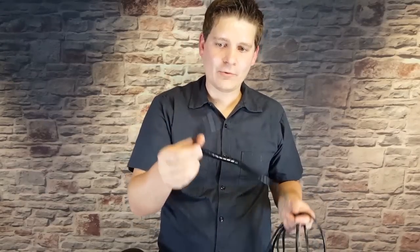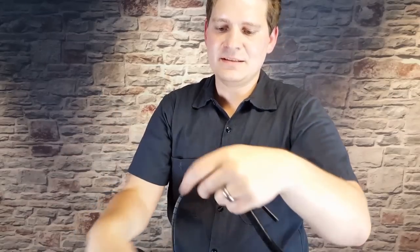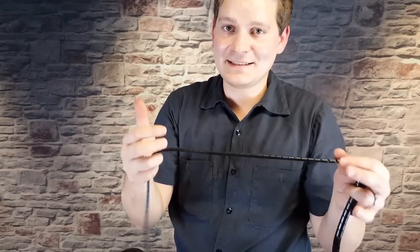There are a few different things you can get - some different wire wraps. This one splits in half so you don't have to twist it around, which makes it really easy to put on. This is a smaller one and it comes in different sizes, so be aware of that if you're looking at a picture online. I used to use these a lot because it looks nice and clean and keeps everything tight. The downside is if you ever want to change anything or access your wires, it takes more time to unwrap things. So usually I stick to zip ties and just try to do them spaced evenly. It looks nice and clean if done right, and makes it really easy to cut the zip ties off, pull wires out if you want to change a throttle, and then just put a few new zip ties back on later.